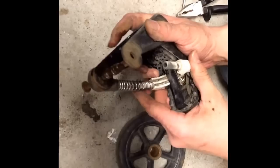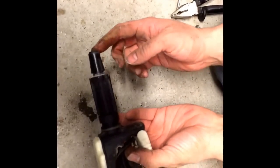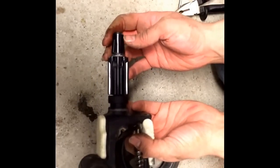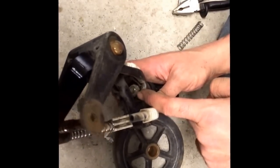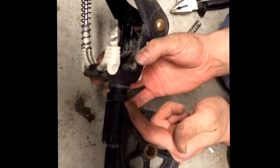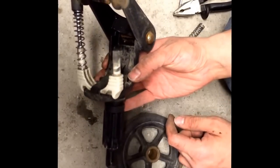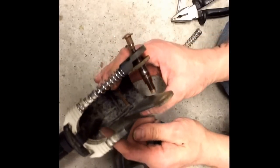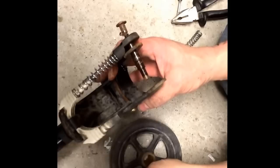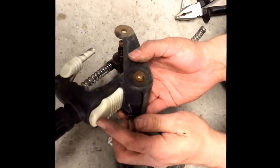In the meantime, I wanted to show you some other parts. Sometimes this top shaft breaks and you can't get the wheel to sit tightly anymore, so you need to replace the shaft. The way you do that is there's a screw underneath — if you unscrew that, you can pull the whole shaft out. Inside here sits a ball bearing which is actually the same size as the ball bearing for the wheel. You can unscrew this and just replace it with another shaft. You need to get around this rubber belt, so sometimes it's easier to remove the wheel. The rubber belt is difficult to remove as well as the back part, so I would recommend being careful because I have not successfully removed either without breaking them.